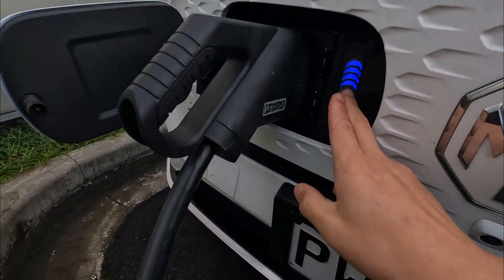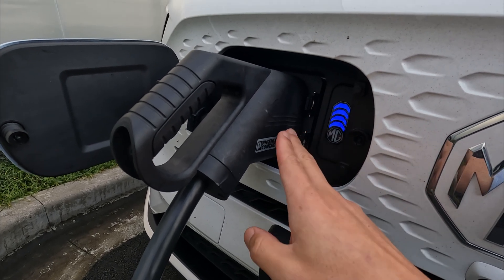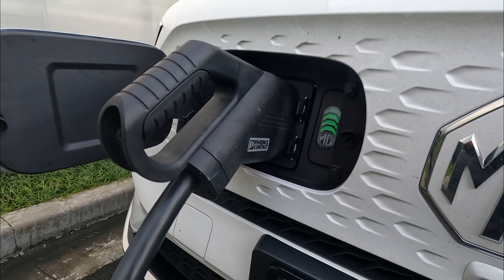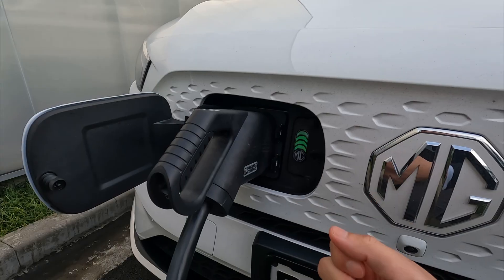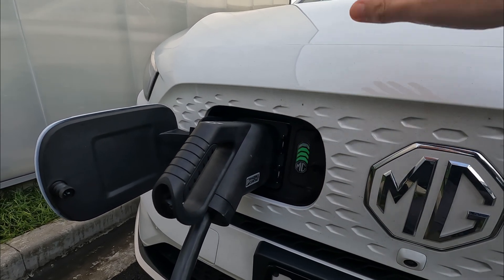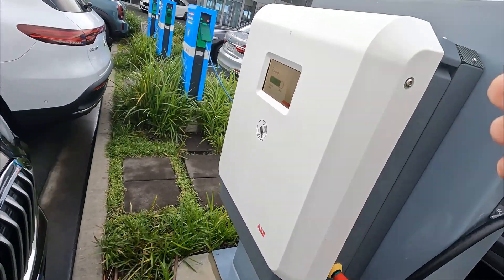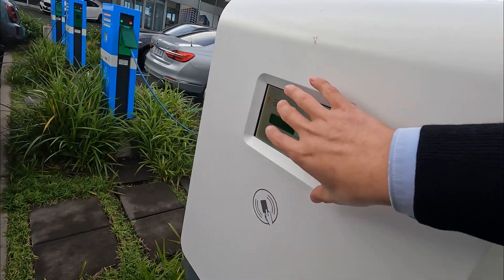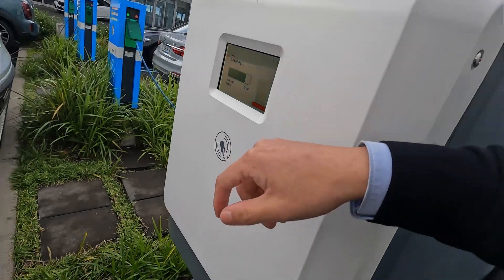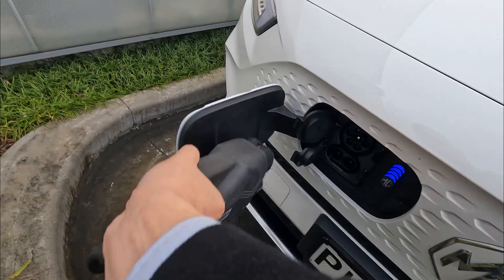Because the vehicle has not set any scheduled charging, once the blue light is gone it will change to green — that means it will start charging straight away. Just like the standard Type 2 charging, it will show the blinkers on the front and show everything on the dashboard about your charging information. On your charging station you'll also find all the information, whether it's a paid or free charging station. We're going to stop and unlock the charger now and safely pull this out.